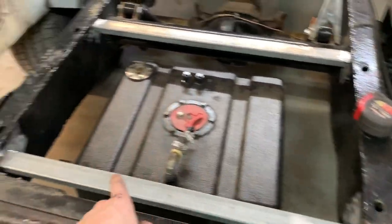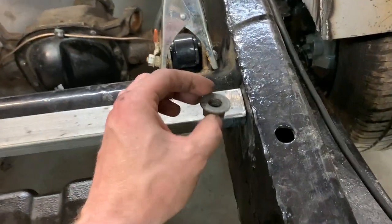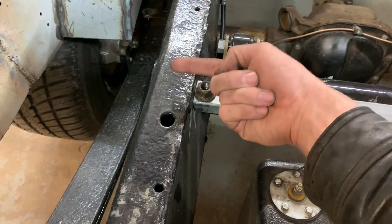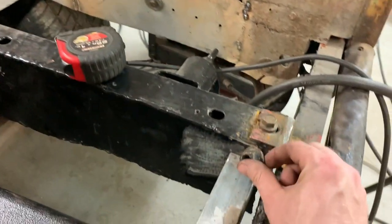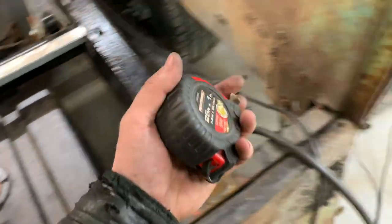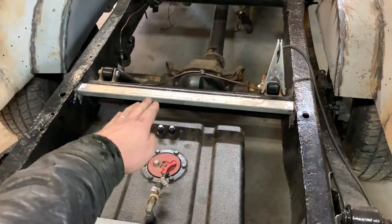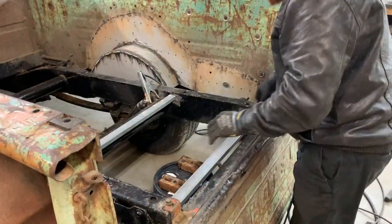These are square this way and that way. I used a nut to make sure it was level — I laid it on the bar and tapped with a hammer until it didn't go down anymore on the frame, then did the same on all four points until each bottomed out flush. Trying to read a kinked measuring tape to a half inch is kind of annoying, so I used something that won't change — like a nut. Everything's ready to go now. I just need to set my height, level up the fuel cell — I'll need my phone for that so I can't video — then I'll start making the straps. Going to go ahead and tack these in.